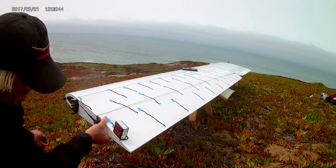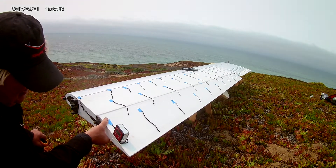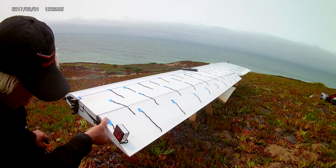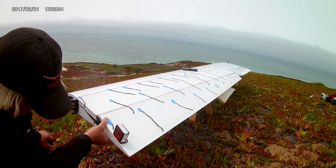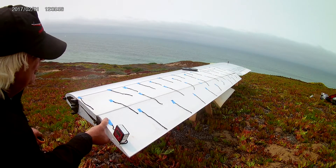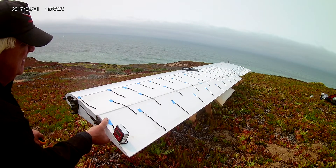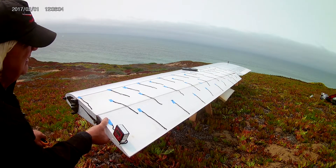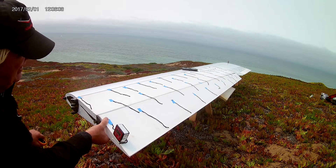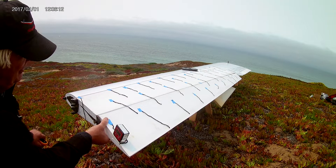There's 14 right there — still well behaved at 14. Coming down to 18, they start to go inboard. That's 19, that's 15 — there's 20 right there. Wait for a gust of wind, hold it at 20, wait for a gust. The tufts are having a hard time staying attached inboard; outboard they seem to be doing okay.